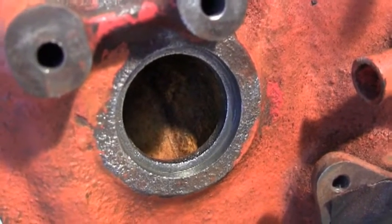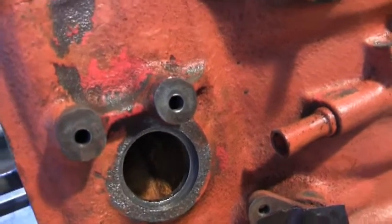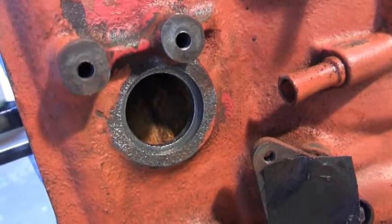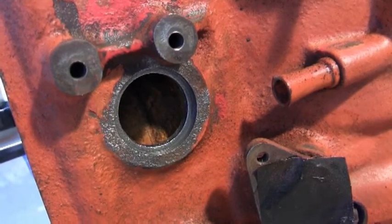You can use a little bit of red sealant around the side. Now, some people say you don't need sealant when you're replacing a core plug, others do. It's difficult to know which way to turn sometimes, but I'm going to use just a little bit of red threadlocker sealant around the edge as we put the core plug in.